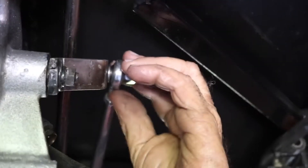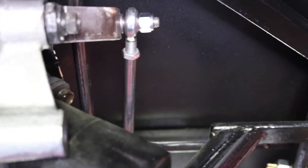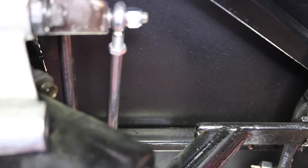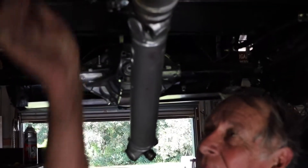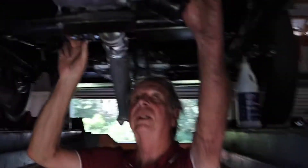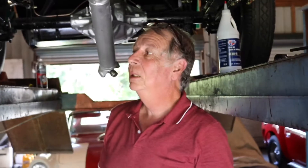This is where the adjustment is. We can take this off, unscrew it, and screw it back in. I didn't have any left-hand threads so I made them solid here - you'd just pull it out if we have to adjust. Right now everything works perfect. It's exceptional - I'm impressed because it looks like somebody else did it. You can see it's in neutral now, and then if you put it in gear - this one is first and reverse, this one's second and third. Three speeds of fury!